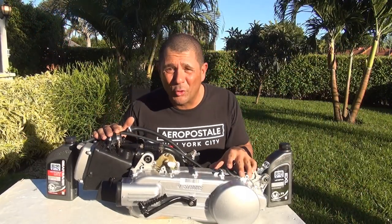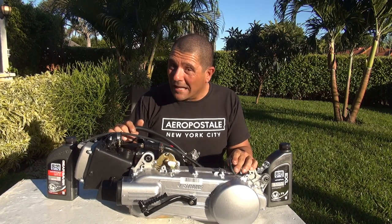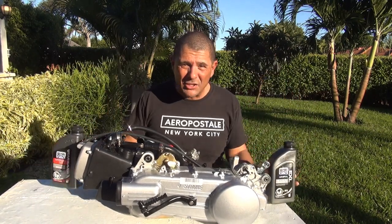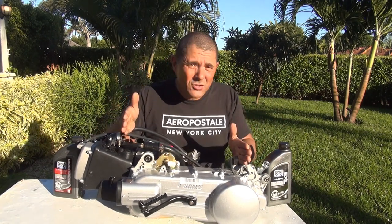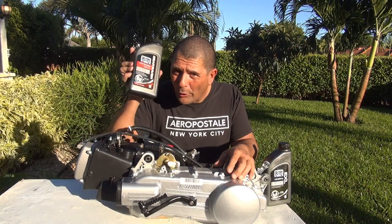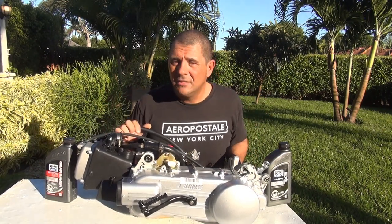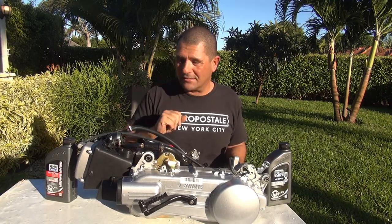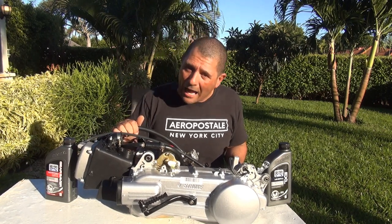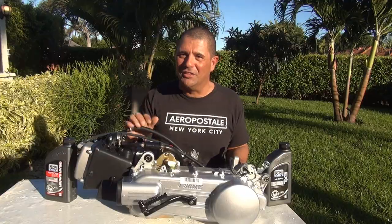At the end of the process, check your motor before you install it on your scooter. The motor looks healthy and undamaged. You have two oils: gear oil and motor oil. There may be some shipping oil inside — if so, drain it and place good oil before you turn the scooter on. I'd like to thank you very much for watching. If you have any questions, feel free to ask. For a motor like this, go to PartsForScooter.com in Florida — great service, free shipping, and high quality. Subscribe to my channel and click that like button. Thank you very much.